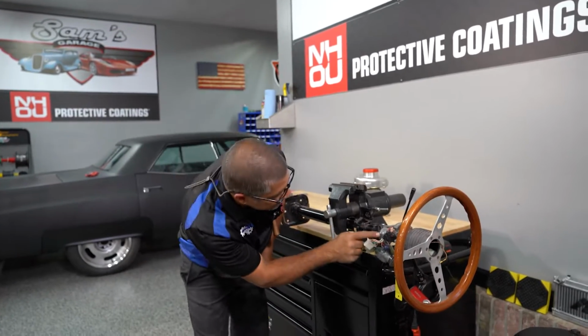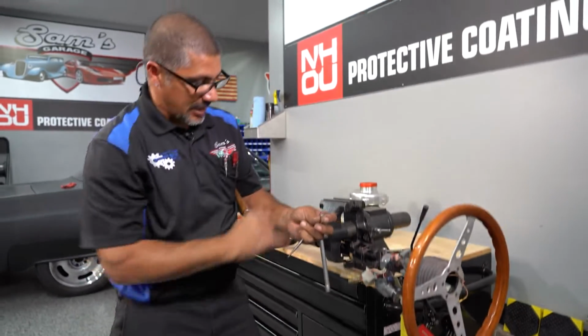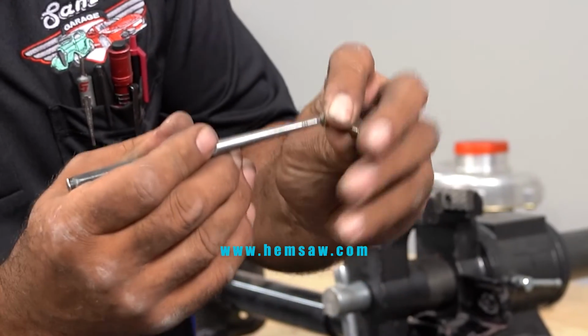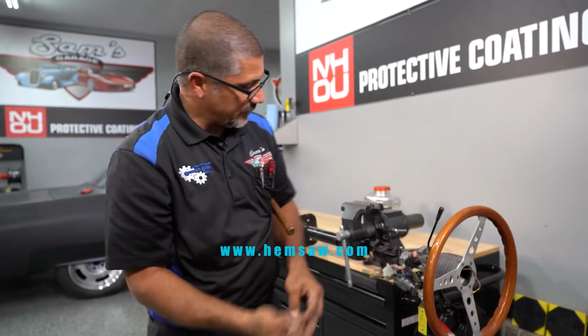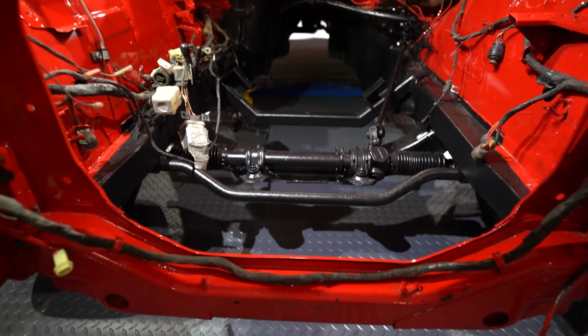In this case, the aluminum mounting bracket is actually flush with the top of the bolt, so I would have cut into that. One way you can do it is take a sharp punch like that, put a hole in it, then use that hole and use a hammer and twist it, lefty-loosey, and it'll eventually come out. Then when you go to replace it, just put in two new screws and hopefully no one will steal your car.